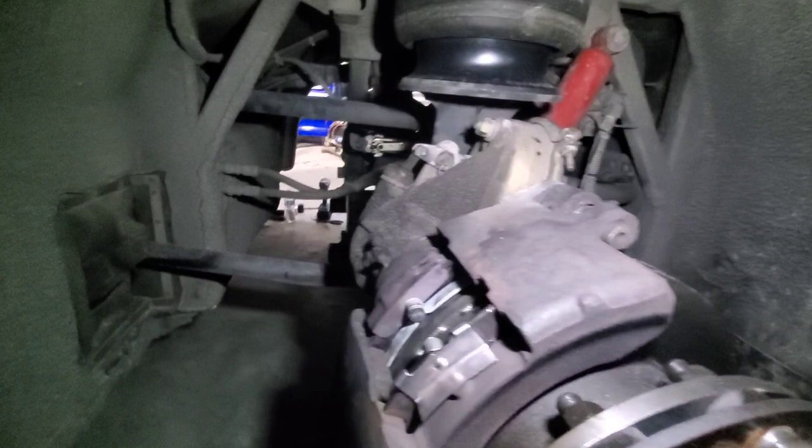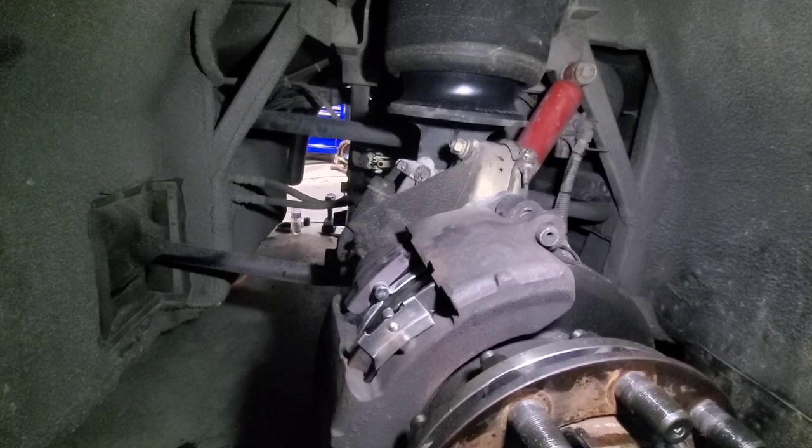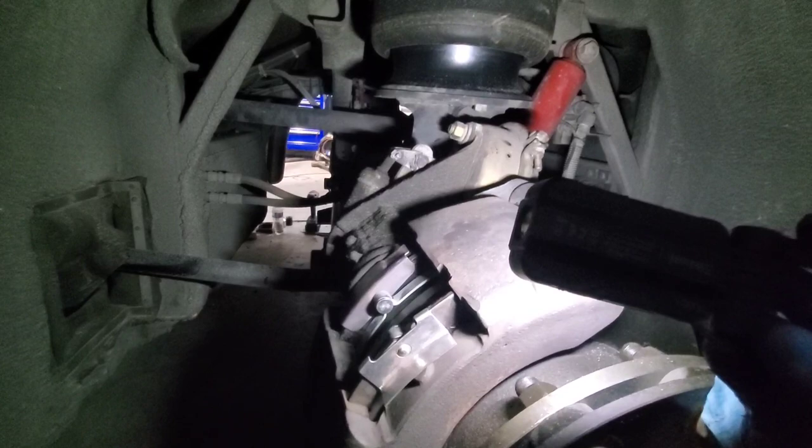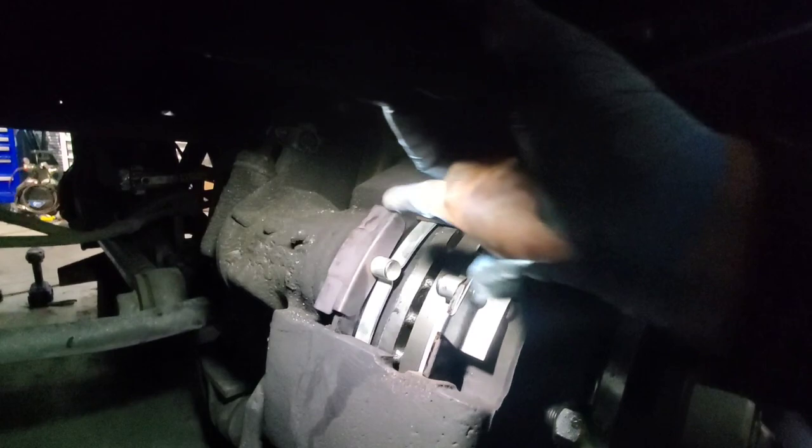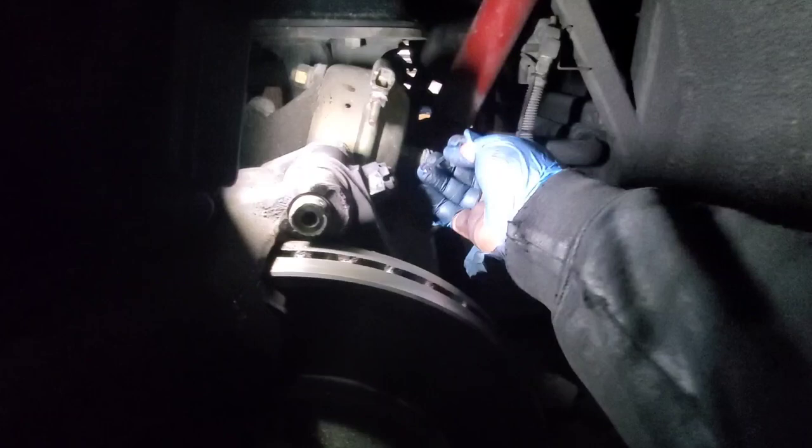That's about it — all that's going to be left is to do your brake adjustment on your slack adjuster back there. But again you're going to want to look at the manual for the vehicle you're doing because that adjustment could change depending on what axle and what vehicle this is in. It's also going to matter whether this is on a steer axle — if these are on the tag or something like that, there's a good chance they will also have a different adjustment. But that's it, they're not too bad to do. The worst part is going to be getting those pads lined up in the little grooves to get them pushed back because it is a pretty tight fit. Last thing: make sure you don't forget to put your cotter pins back in there because you do not want these to back off on you — this is what's holding the pins to lock the caliper on. We've got those on and now I've just got to adjust it and probably put a little more oil in that hub, and this thing is ready to go.